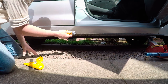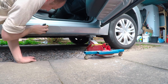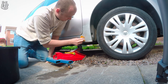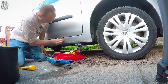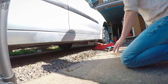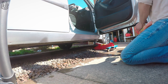So now I'm using the rubbing compound — again this is from Halfords, quite cheap, really effective stuff. Now obviously the paint — this is a couple of days later — the paint had not fully cured, but it cured enough that I could use the rubbing compound. Also this paint is obviously fresh and new, and the paint that I'm blending it into is what, 10 years old if not older.